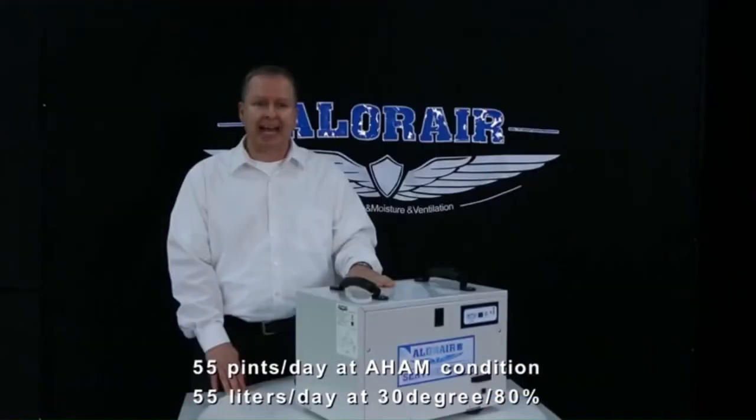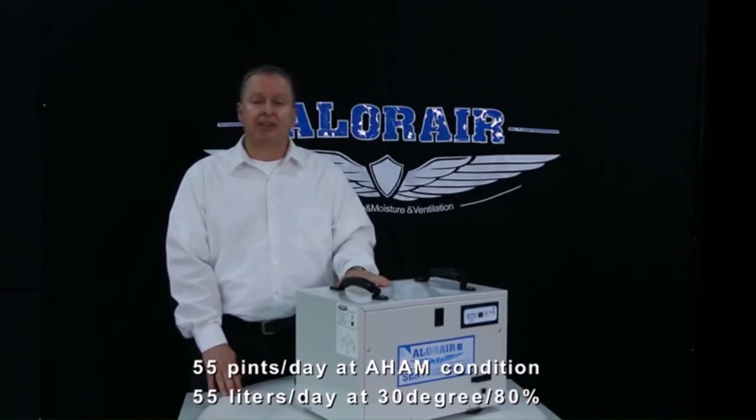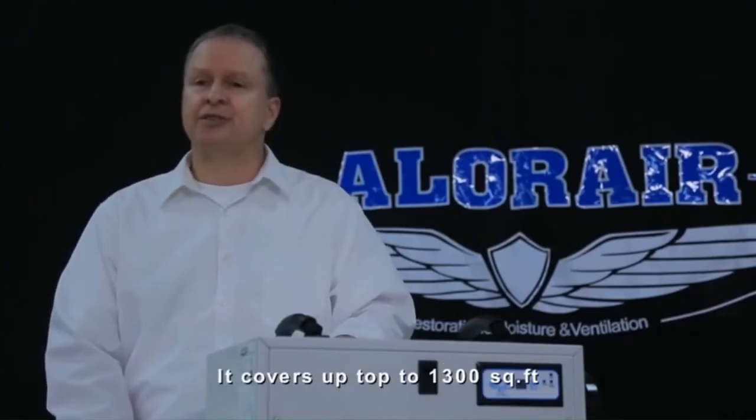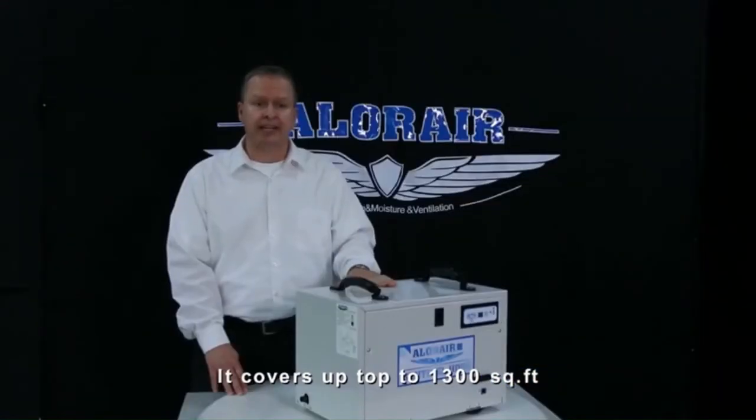It can remove 55 pints of moisture per day at AHAM condition with a current draw of 3.9 amps, and removes 55 liters per day at 30 degrees and 80% humidity. It covers up to 1,300 square feet and it has impressive water removing efficiency with 5 pints per kilowatt hour.